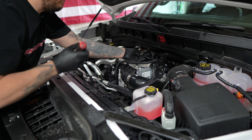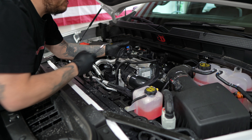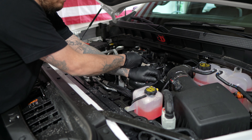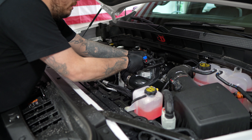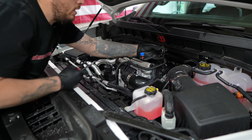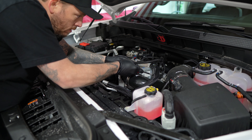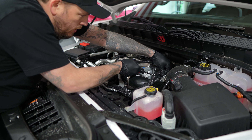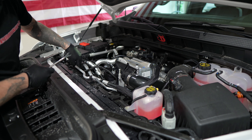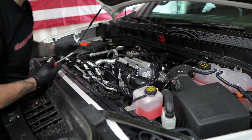Slide the lock back, push down on the clip — be very careful, you don't want to break anything. This is our charge cooler temperature sensor one, so I'm going to slide off that lock, push down and pull that off. We'll take this off so we can get the harness out of the way — that just folds out. Now we're going to work on the knock sensor and take off the bracket.